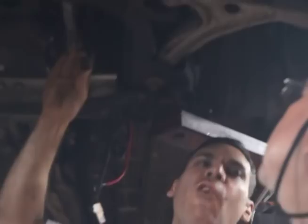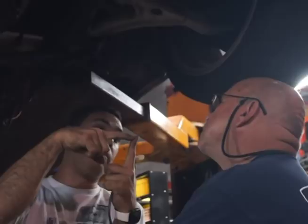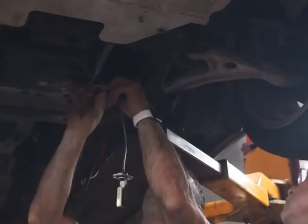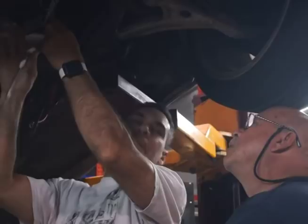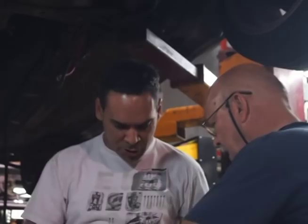That's my concern, because this is only sending back a ground signal, obviously. There's no power down here. So you ground when it closes or opens the circuit, correct? On a one wire, yeah. On a two wire, obviously they do this when it's normally closed, and when it loses oil, it opens the circuit. But here, the circuit only opens on a ground on a single wire. So what I'm thinking is I just need to go to the black on this one, but I need to test it. And that's what I'm asking. I think I only need to use one of these because one of these is ground already, and the other one allows it to happen when the sensor activates in the RX8 version, but in this one it just sends you to the ground. When this thing clicks, you just click ground to this wire. I got an RX8 oil pan handy. Let me take a look. Thanks, I appreciate you.